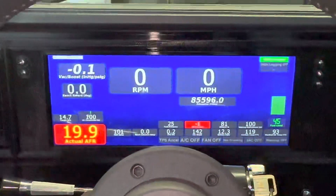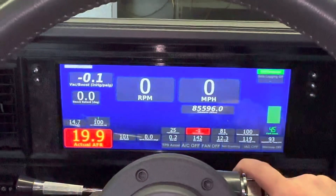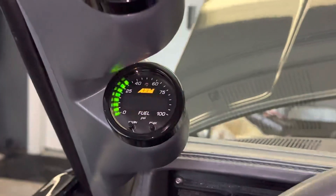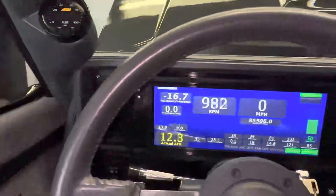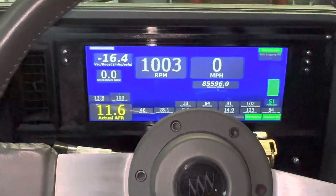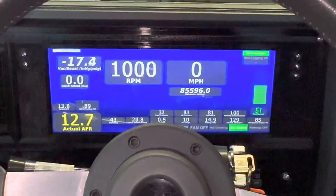I'm going to set the dash back up to normal and let's start it up and see what it's idling at. If it is really just on one fuel pump when it's running, I should have about 32 or 33 pounds of fuel pressure on this dash indication. It's showing about 32 to 33. My fuel pressure gauge is showing 29, which is normal — I usually see about 29 on that gauge and roughly 32 to 33 on the dash. It's two separate pressure sensors, one for each circuit — I have some redundant sensors on here just to cross-check. It looks like everything is right. If I was to go out and drive the car right now, we should be driving on one fuel pump, and then the second fuel pump should kick on once the ECU sees 200 kPa and 3500 RPM.